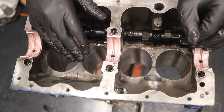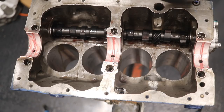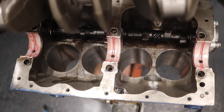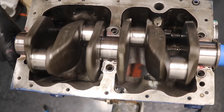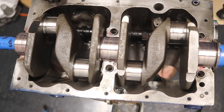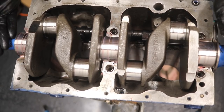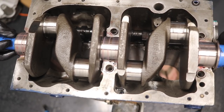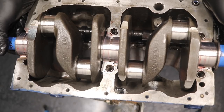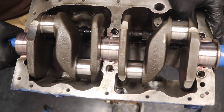That's not something to worry about on a 1275 generally. Now we can grab the crankshaft and set it down into place. There's only one way the crankshaft goes in. Your crank sits down right into those bearing faces. On one end is where your clutch and transfer case go — the side with your oil pump. The other end is where you put your crank gear that connects to the timing gears. Now, there's something called end float, which is how much your crank moves from side to side. You want to prevent end float, and you need to measure it when rebuilding a motor.